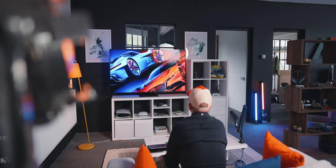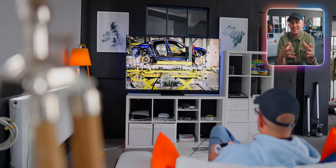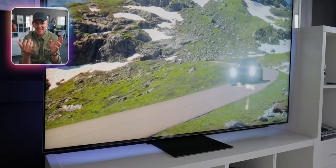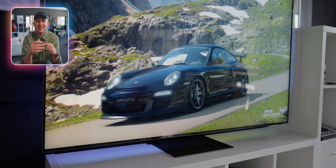Just find an HDMI port that is not ARC and everything should work okay. Then you connect all your other devices like your TV box, your PlayStation, Xbox, or Switch. The sync box is basically a hub - you connect the sync box to the TV, then your devices to the sync box, and that's how the sync box will know how to synchronize the lights to whatever is showing on the display. This could be your PlayStation, Xbox, Nintendo Switch, or if you have a TV box like Hulu or Sky here in the UK. As long as it's HDMI, it will sync up.